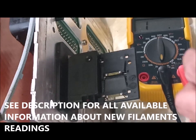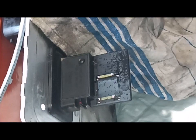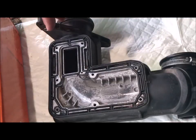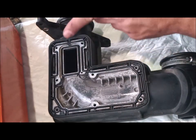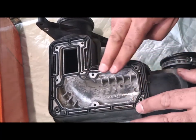Since I don't actually know the original resistance specification from Mercedes, I'm going to clean it carefully. Don't push too hard because the filaments are very thin. We'll use the air mass cleaning liquid, very carefully, very mild — try it first. I also place the gasket back in its position and clean it along with the air mass flow sensor from the inlet, since I found a gap between the gasket and the air mass flow. Cleaning everything will give better seating and contact.